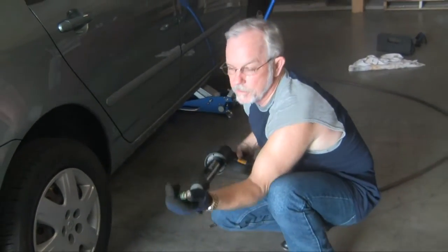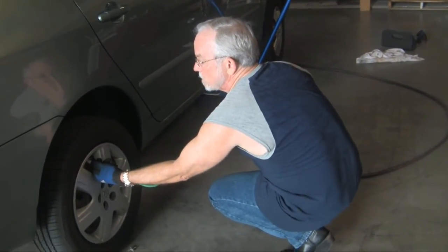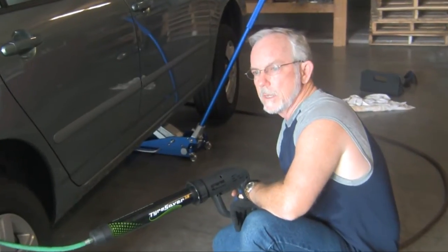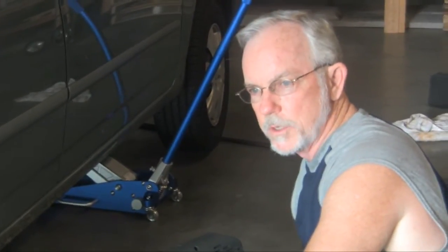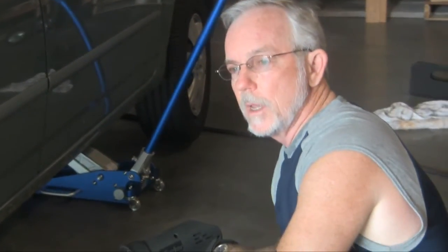And we're going to fill the tire with nitrogen. We're going to release the lock, put it on the valve stem, and we bring the tire up to the manufacturer's recommended pressure — in this case, 32 psi. At that point, what we will do is we will dump all the air back out of the tire again. It's going to be nitrogen at this point. And what we want to do is we want to bring the percentage of nitrogen up by filling it the second time.